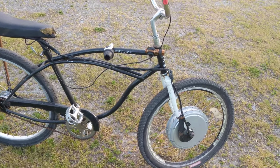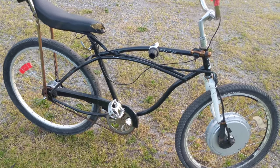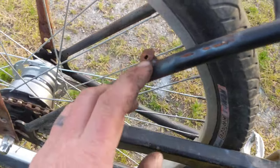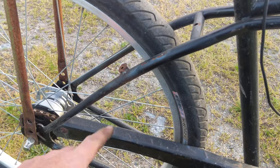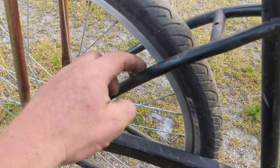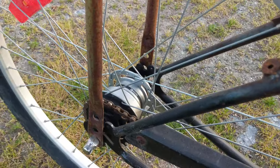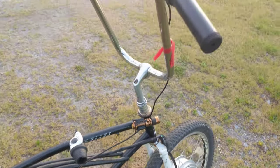I'm going to get this working really nice — get the battery replaced or rebuilt, and then probably strip it and clean it right up. Finish the shifting mechanism. It's got a coaster brake in it, so years ago I welded brake tabs onto this frame because I had a different wheel with a freewheel. That's obviously been reused, so I'll probably end up taking those off or cleaning them up, because this has a coaster brake — when you pedal backwards there's a brake inside that hub. Don't really need to mess this bike up with extra brake cables and shifter cables.